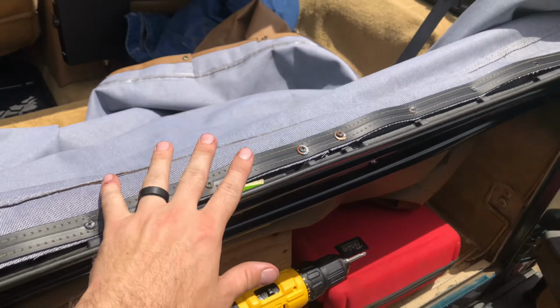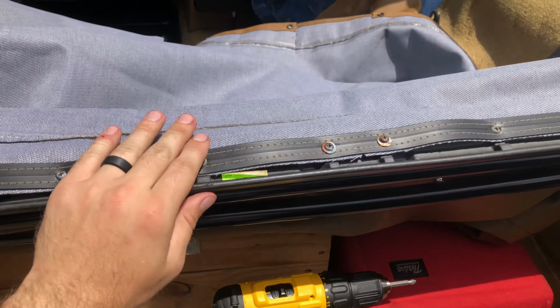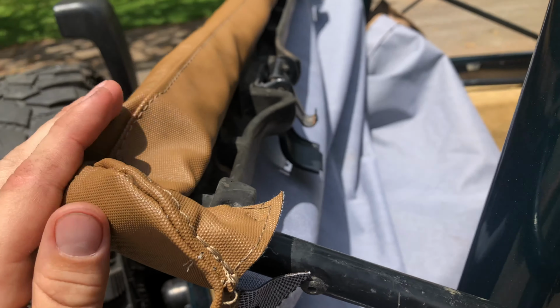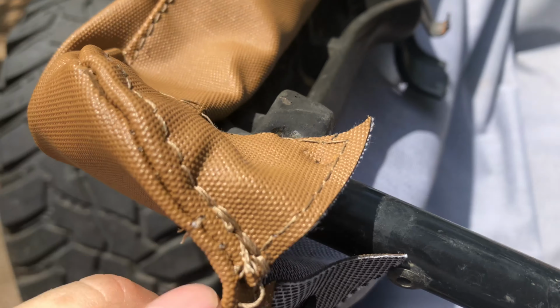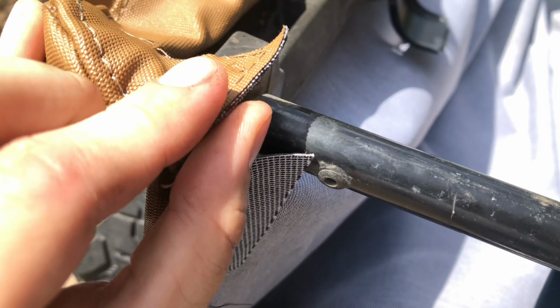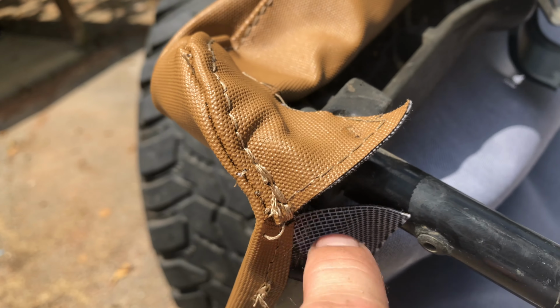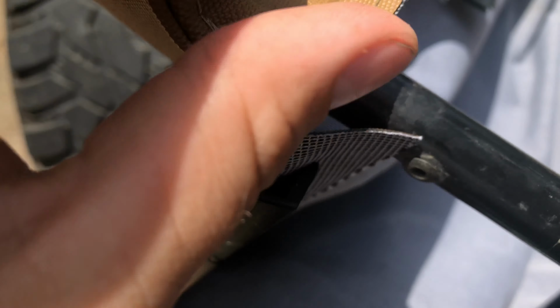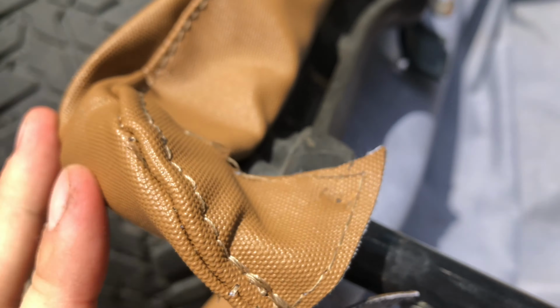And basically your step after you got them screwed down is to take the top and pull it over this windshield bar. So after you pull it over your windshield bar there, you make sure you get this corner, the first two screws that we took out with that little hole on your old top, it's going to be tucked up under there, so make sure you take it and pull it out on either side, so then you can screw those down into their holes that they were originally in.